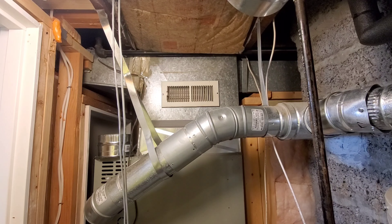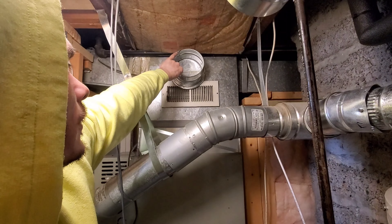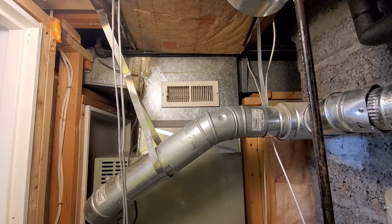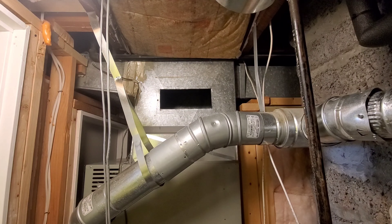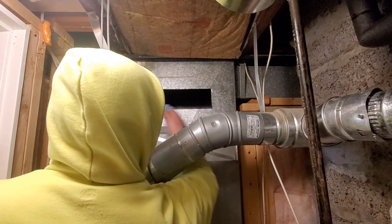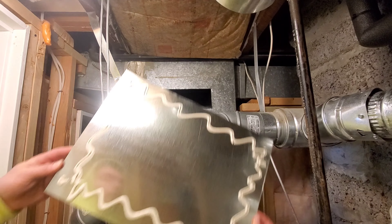So what needs to happen here — I need to install this takeoff. It was in the way, so we're going to install a new piece of sheet metal. Here's the piece we cut. First things first, we gotta degrease the metal and take the dirt off. The new panel I got has grease on it when you buy it new, so use some kind of degreaser. This surface you want nothing to come off of. Got the panel all glued.